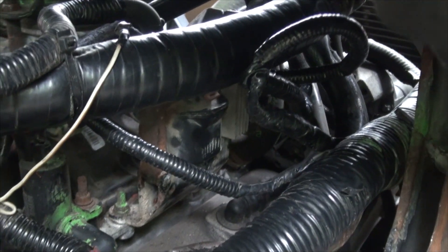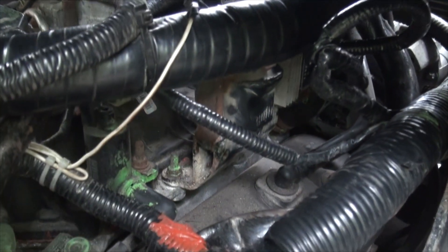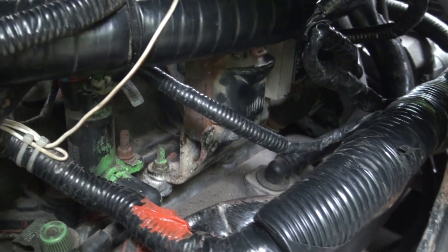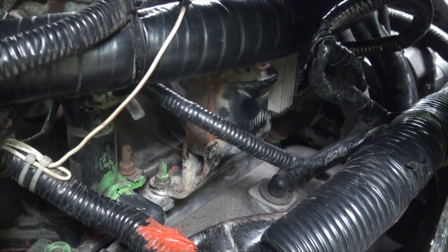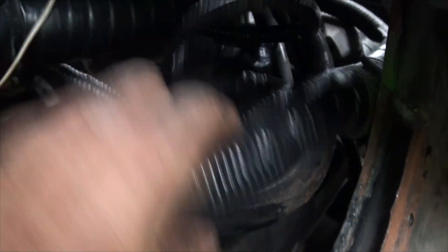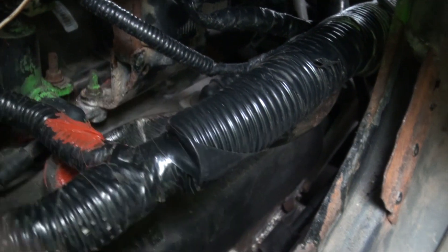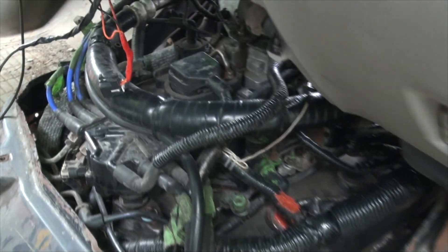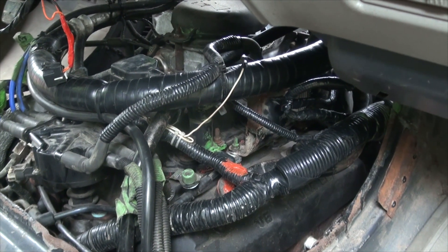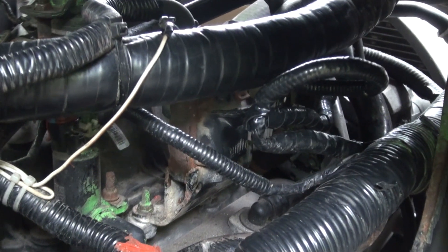The coil is not super hot, but it's definitely running temperature. It would get hotter if I had the doghouse on, but that didn't matter yesterday because when it broke down I was driving at 100 kilometers an hour with the doghouse off — wind was coming right through, so the coil was just as hot then as it is now. If I shake up these wires now, nothing dies. I can shake up the whole thing. The last time I shook them up the engine died, so I'm pretty sure I have it fixed now.